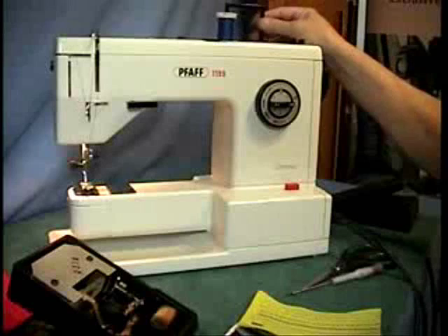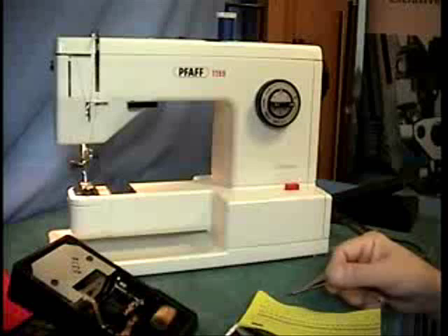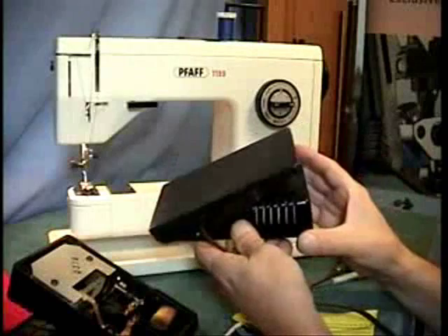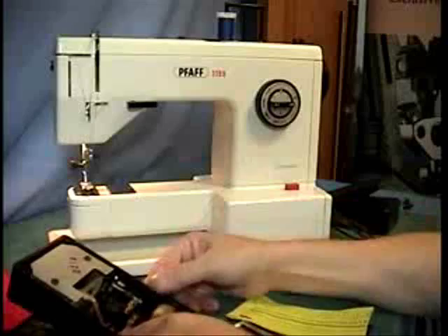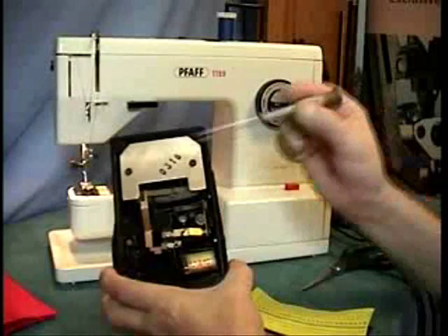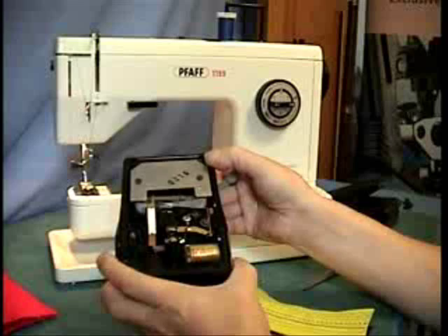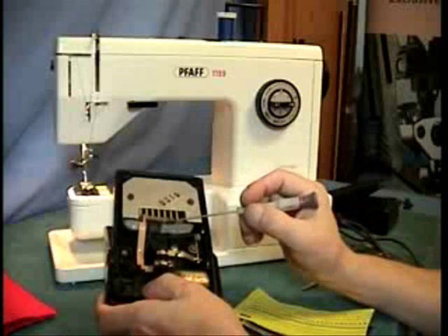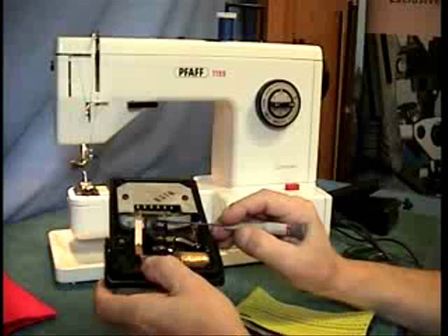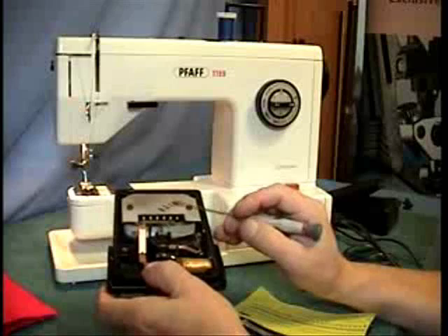This piece up here — this is Judy's, not for sale. Now this comes with the original foot pedal. To show you what's in this foot: it has a coil, just like the old crystal radios, and it has a capacitor. When you squeeze it, the little arm here will run up and push on the coil, just like the old crystal AM radios. One problem is that these little coils tend to break, and her original one got some corrosion on it and it actually snapped the wire.